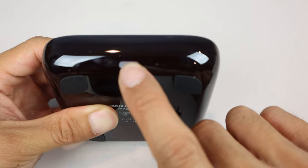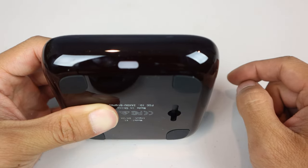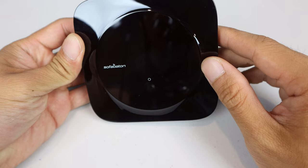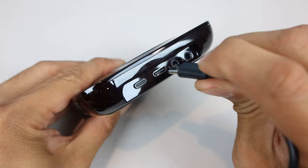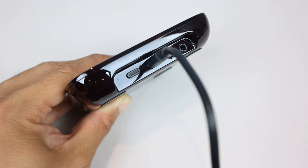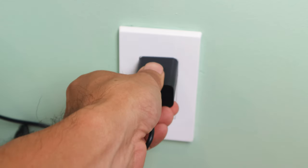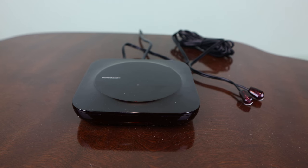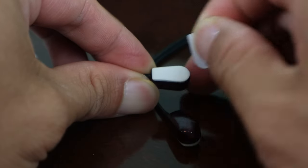At the front, the LED will flash blue when Bluetooth pairing is activated, as that's how it communicates with the remote. On top, this dot is where you'll point your other device's remotes if you need to manually program their signals into the hub. This hub will require constant power, since it's what sends out the commands and IR signals — not the X1 remote itself. The IR blaster extenders are optional and help the hub communicate with devices that its built-in 360 blaster doesn't have a line of sight to, like devices on shelves or behind cabinet doors. The emitters are pre-fitted with double-sided stickers so you can mount them in place.